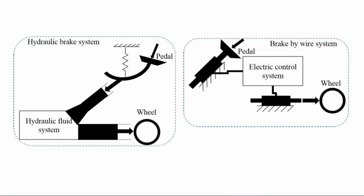The brake pedal and disc are retracted from pressed positions to their original positions using overhanging spring mechanisms that connect the pedal to the vehicle body. Brake-by-wire systems were developed in recent years with the development of drive-by-wire technology. These systems are designed to reduce mechanical and hydraulic system usage in vehicles. Brake-by-wire systems transfer pedal force to wheel brake discs using electrical and electronic circuits without hydraulic force transfer mechanisms.